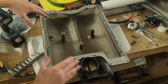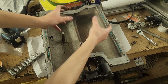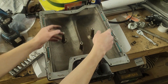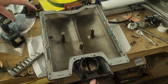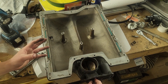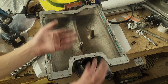Here we've got the lid off the supercharger. Here is the bypass valve. The supercharger snout is here, and then the twin screw assembly forces compressed air into this lid. That air goes down into the intercoolers and into the engine. So you've got compressed air in this lid, but not compressed air within the snout. This bypass valve is what allows that compressed air to flow back out and become uncompressed. In low throttle situations, this actually opens up. When you get on the throttle, it'll close so that the air can compress and go into the engine. For efficiency's sake, we let it bleed out to the snout.